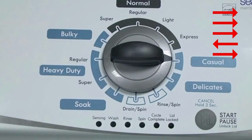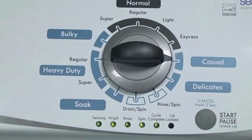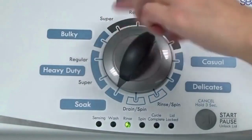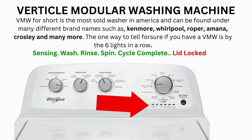If the status lights don't blink, try again — this time turning the knob faster or slower. In diagnostic mode, with all lights flashing, select the calibration cycle by turning the control dial 4 clicks clockwise. When you're on the correct setting, the rinse light turns on — then simply press start. The calibration cycle runs for 2–3 minutes as it checks all the cycles and functions on your machine. When the calibration cycle ends, if all goes well, the lid unlocks and the washer shuts off. Now try your washer to see if that solved your issues; if not, continue to the error code video.